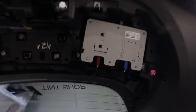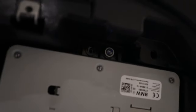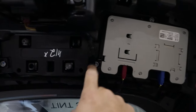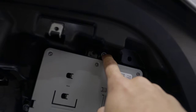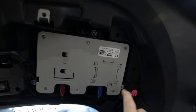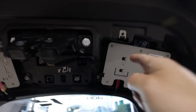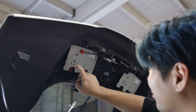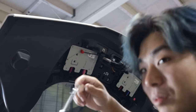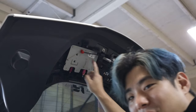This is different — okay, so you're missing a screw here. I really did get a rev car. My 2020 had a screw here, here, here, and two screws there, but this one just has one screw. It's probably for cost savings. So I think this is a T25 as well. These are just Torx screws — you're going to want to take all these out. For clarification, the size socket you need for these bolts: T20. So you have T25 for this one and T20 for these ones.